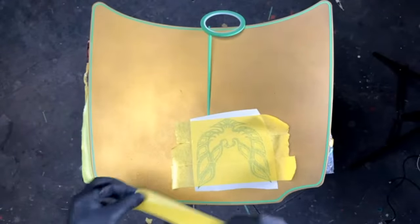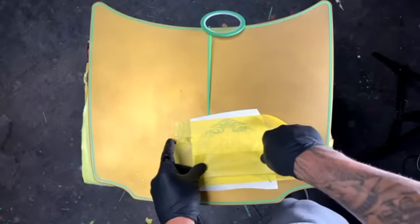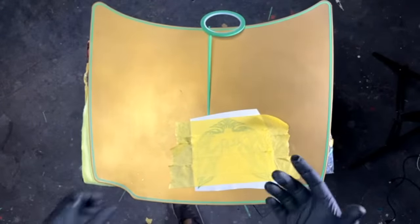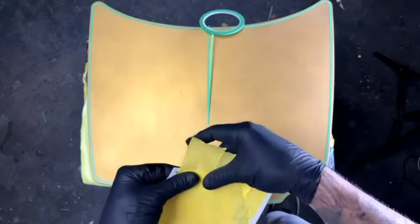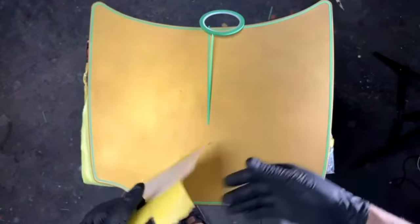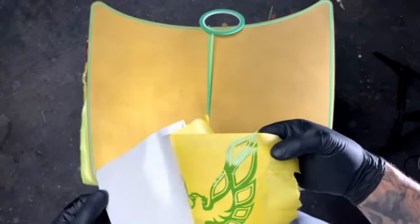The Sig P said, can you do candy flames over solid color, or would it be too transparent for the effect to work? Oh no, that would definitely work. Yeah, it would look more like a pigmented color, but it actually looks pretty cool too. Transparent candies always look better over a pearl or a metallic, but I've sprayed them over base coats and it just gives it a more solid look.